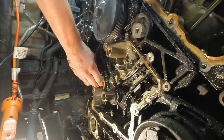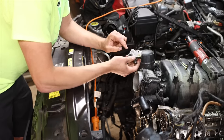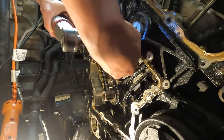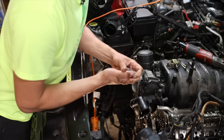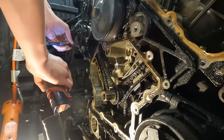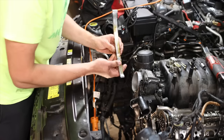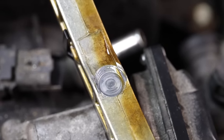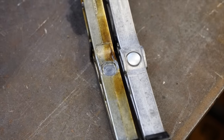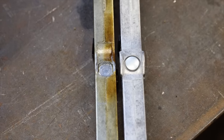The first thing we do is take out the tensioners — you can see what they look like. Definitely the old-style tensioner; it still has some spring pressure, which is good. It's hydraulically controlled for full pressure, but this one seemed fine until I pressed it in too many times and now it's stuck — either way, I'm replacing these. Now for the part I'm really excited about — this tensioner is definitely the old design and it is very worn out. Comparing old and new guides: the old design has a soft aluminum surface where it's contacted by the tensioner, which wears out over time causing reduced chain tension. The revised design has a hardened contact point to eliminate this issue.